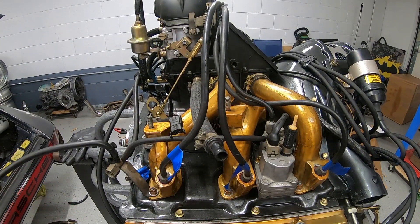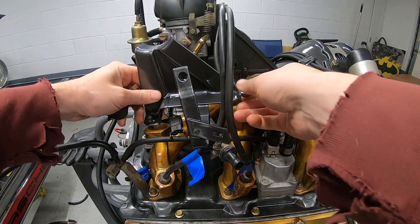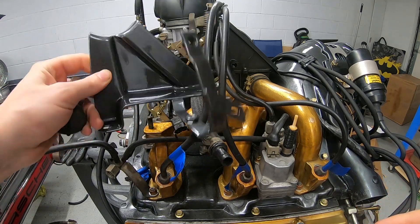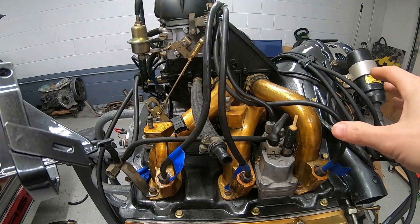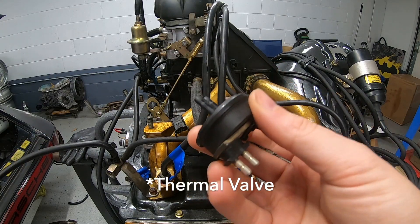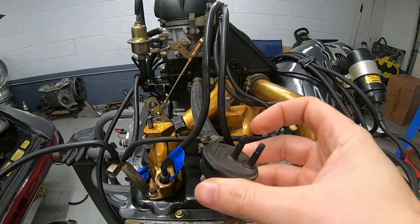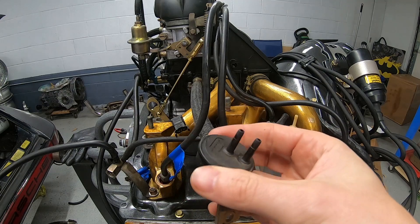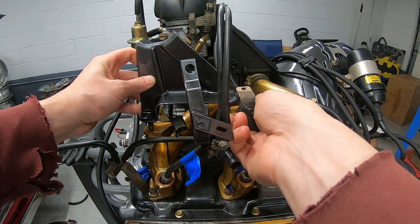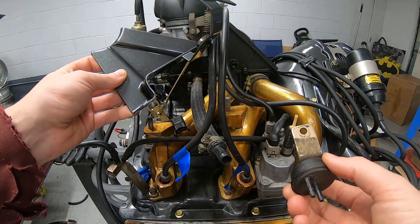When I was taking this apart, there was an electrical motor here with a blower. This powder-coated piece goes on here to hold the blower, but I'm not going to need it because I did the heat backdate. One of the things it also held is this warm-up vacuum component — it's got a little electrical connector that opens a valve after a certain amount of time. That mounted right onto this piece, so I'm going to have to find a different place to mount it since I'm not using this bracket anymore.